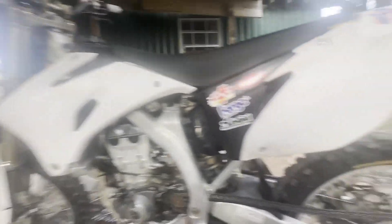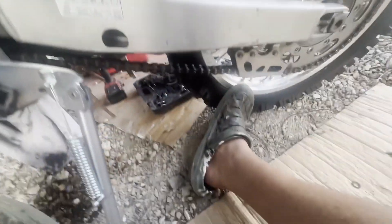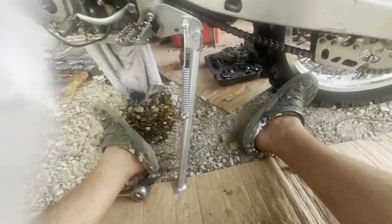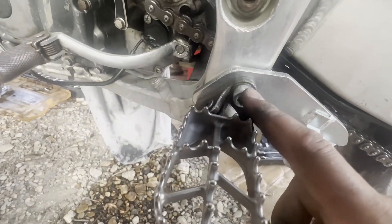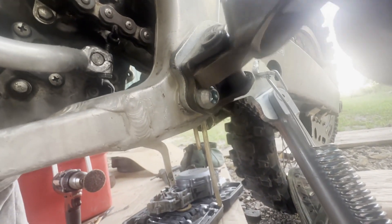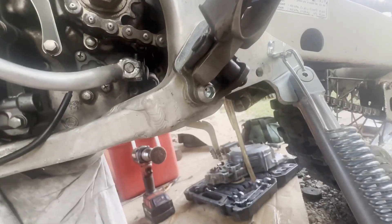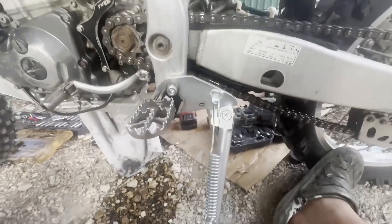This is the foot peg I just installed — super easy to do. The part number right here, MFG number 40 — I ordered this off Partzilla, they're not a sponsor, just telling y'all what I did. You basically just take your foot peg off; it's going to come with longer bolts, and it gives you a conical one so that it can do its job. On mine I found that I had to shave off a little bit right there to get it to function properly. The conical shape helps, but you may still have to shave a little bit off.